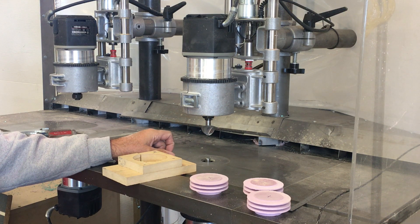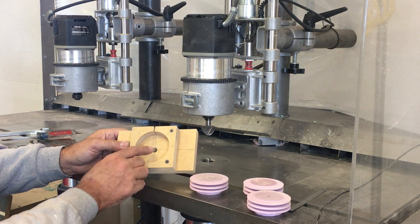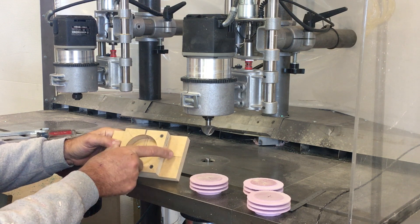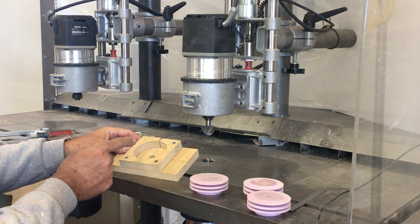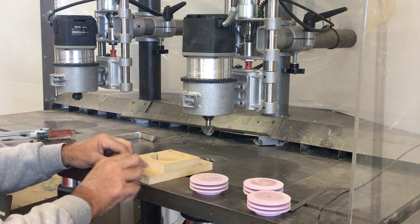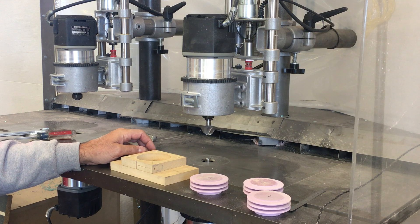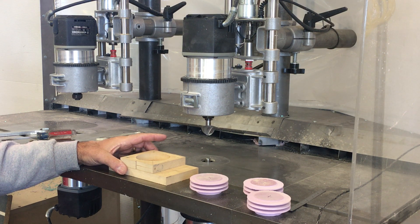This is an inch and a half bullnose bit. What I did was I made myself a little fixture here with the pin and the head mounted slightly off-center, so when I plunge with that bit I'm going to rotate this thing on the pin and I'll get kind of an approximation to that elliptical semi-hemispherical combustion chamber — to get the volume of it about right.